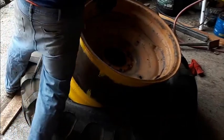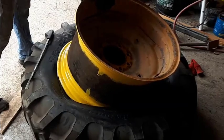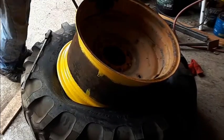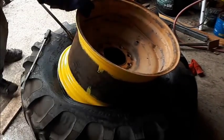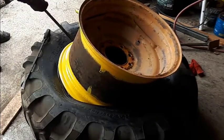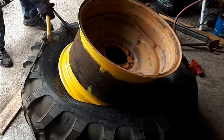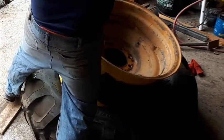The whole job took 30 minutes to get the old tire off — the second one was much more difficult than the first. The new tire took about 16 to 17 minutes to put on. But the step in between you can't forget: you've got to clean every bit of rust off and make sure it's got a really good surface. Two coats of paint — actually I put three on the second one, it was so rusty that I thought the third coat would be necessary.